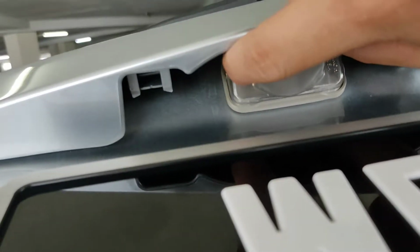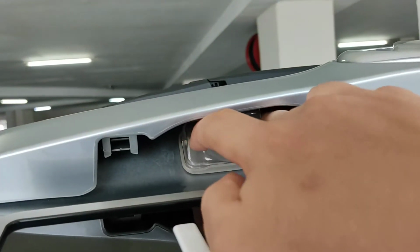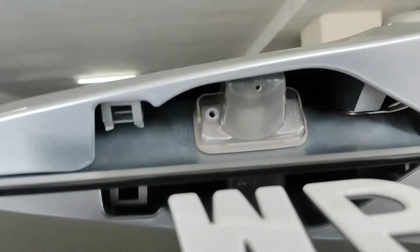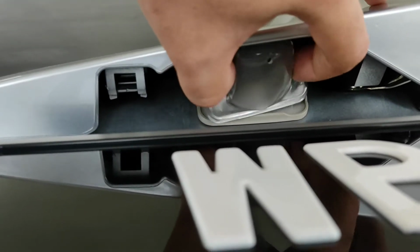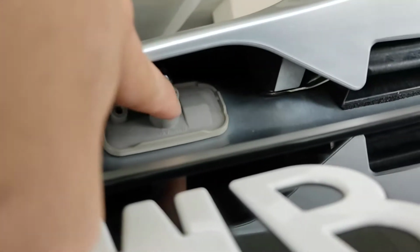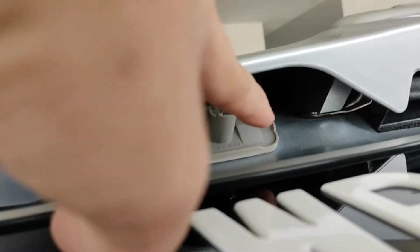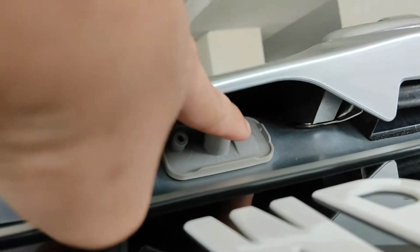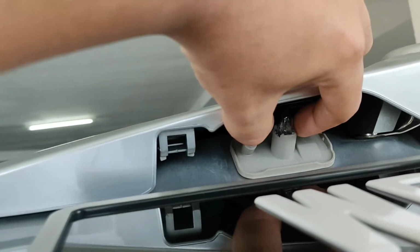So grab hold of the lens and remove it from the holder itself. So slide the lamp to the left and take it off this way. Slide to the left because there is a groove on this side. There's a pole like this on this end and they will catch onto the groove over there. Then remove the bulb which is not working